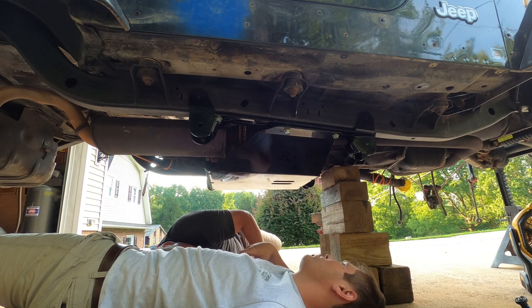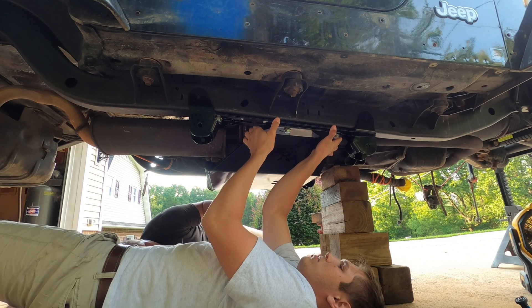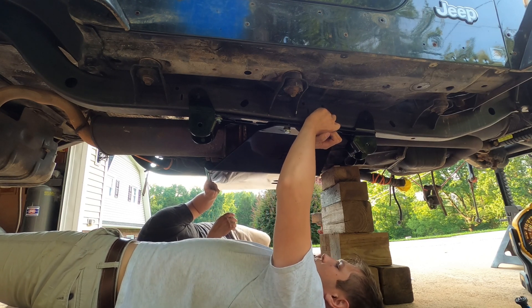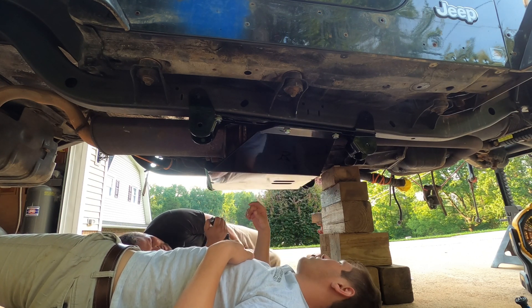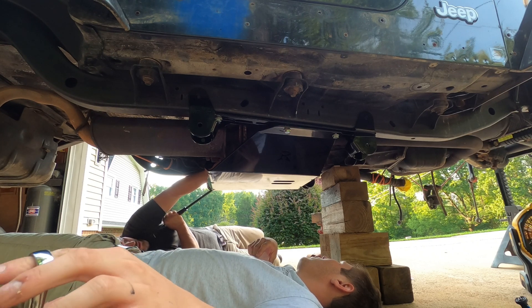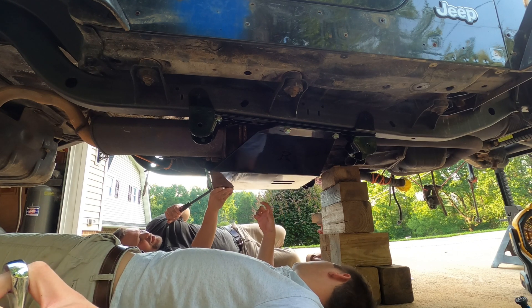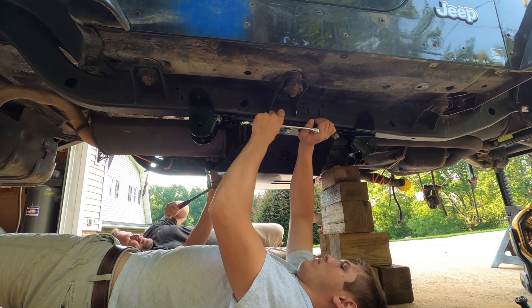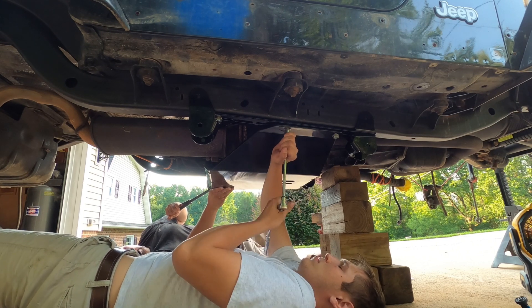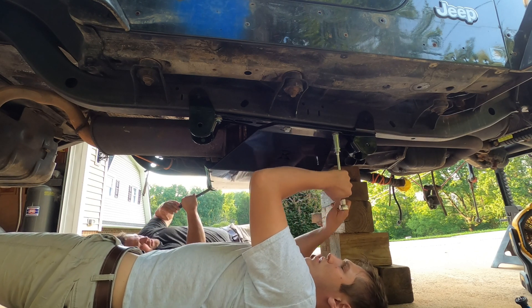We're shifting the transmission over about a quarter to three eighths of an inch — that won't have to happen on every Jeep, but in our situation it just needs to be bumped over a little bit, making sure everything lines up perfectly before we drill the holes. Also, after we pull our frame saddles down, I measured once again from our penciled holes to the D holes to verify our measurements. Third, regarding the transfer case: with this being a Rubicon it's not as much of a concern, but if you've got a Sahara, Sport, or Wrangler X, you're going to need to look into a slip yoke eliminator — and now's the time to do that, to lessen the degree that drive shaft is running on. Anytime you go past about two and a half inches of lift, especially three inches or more, you're going to have to address that drive shaft angle.